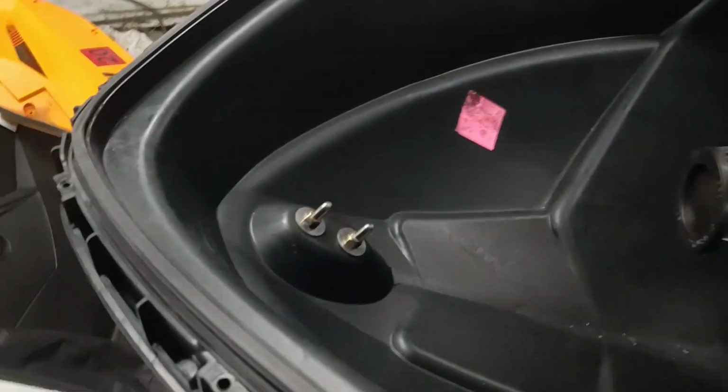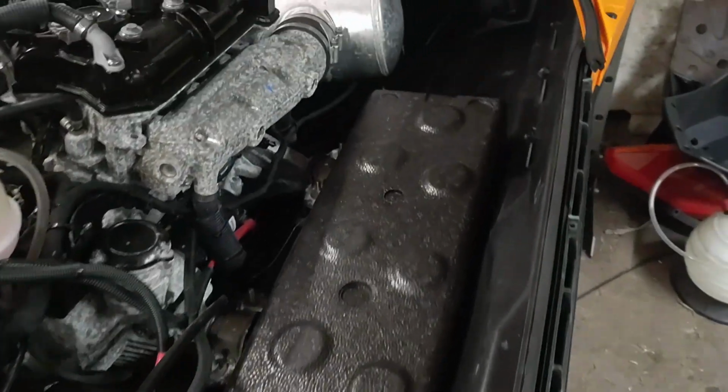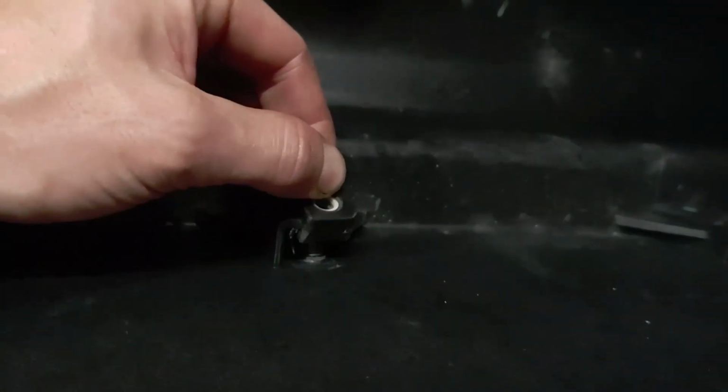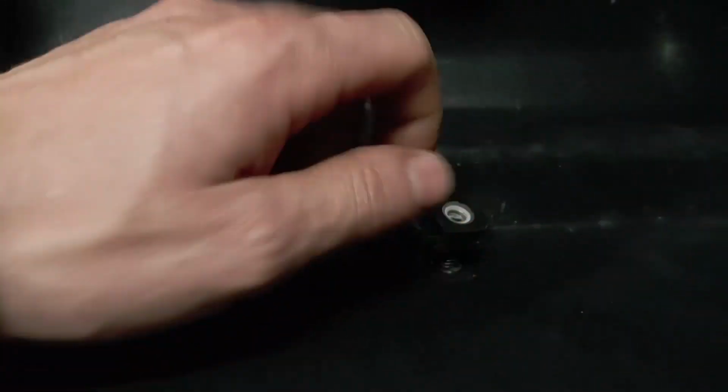We noticed a couple defects in some of the striping right here. It's supposed to be up higher, but really that wasn't the biggest issue. We noticed a big one, which was down here right there. It was a cross-threaded bolt or nut on a bolt here, and what happened is this is oblonged right here. You can see that. And if you're on the water, this is underneath the water line right here on the sponson. So if you're underneath the water here and you're just sitting still like I was for hours fishing, there's going to be water coming through here.